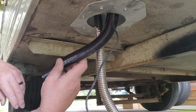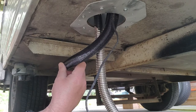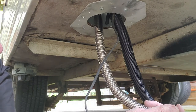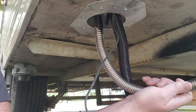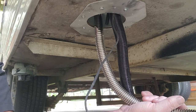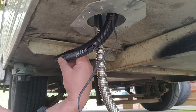I think I'll start with the air intake. What they recommend is to direct it towards the front. I do not want the exhaust exhausting near the air intake — I'd rather have these as far apart from each other as possible. I would like the exhaust to be sending fumes out the back. So I'm going to take this air intake out to the front over here.